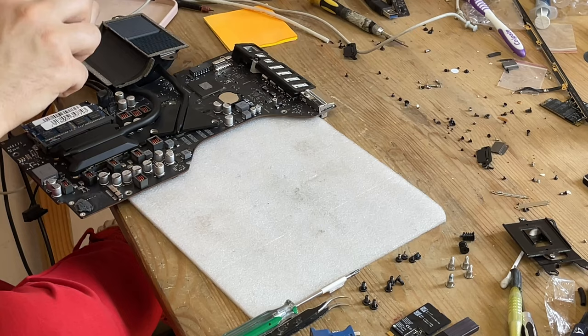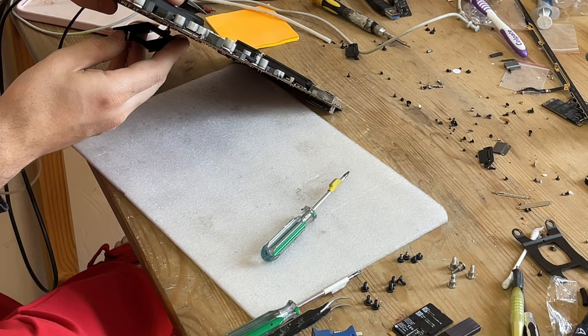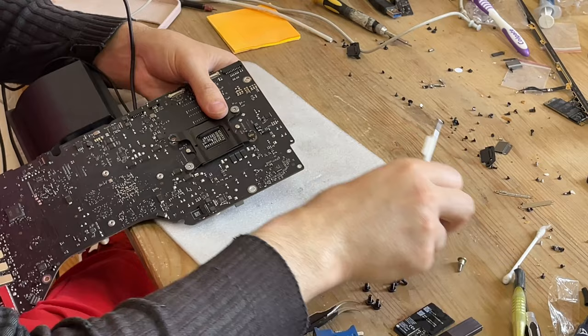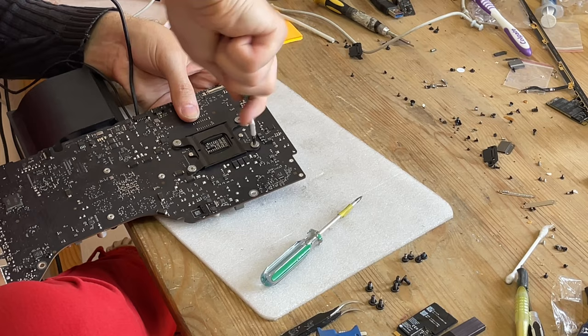Very carefully tighten the screws. Then turn the motherboard over and insert the processor lock so that the processor does not fall out of the socket tray. Hold the radiator with your fingers on the backside, and then we tighten the screws diagonally.